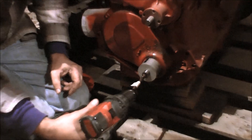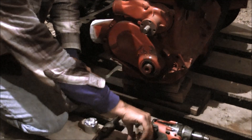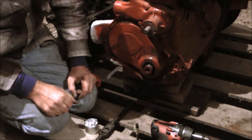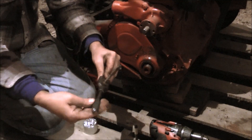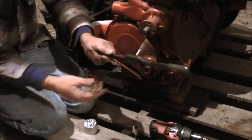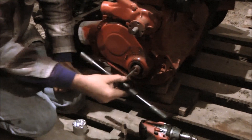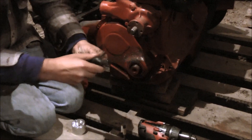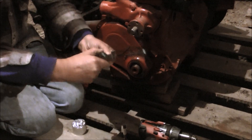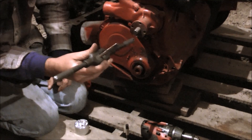Put your drill on and run it into the crankshaft. That's going to take you a little while because crankshafts are not real soft. The next thing you're going to do is take your tap, put it into your tap holder, and you're simply going to tap that crankshaft. Do not run your tap straight into the crank — it is hard. Turn it in about half a turn and then reverse, then half a turn further, reverse. Use a little bit of cutting oil as you're going.